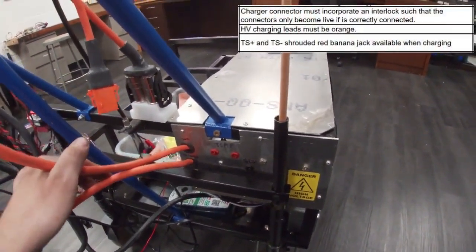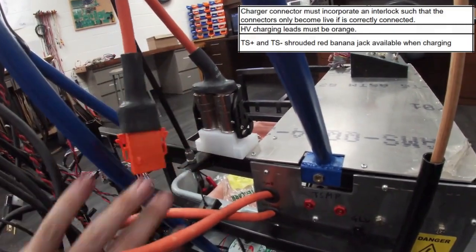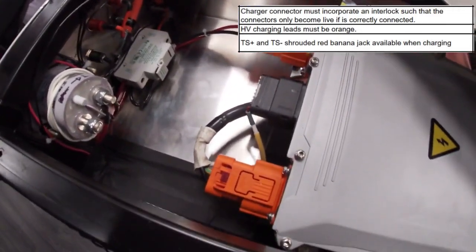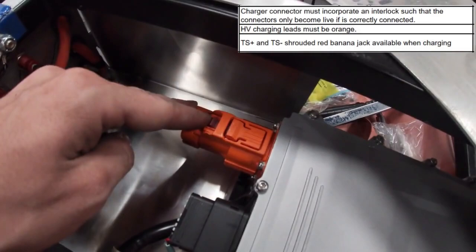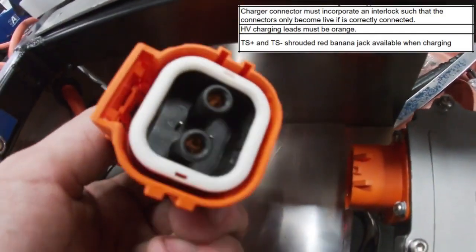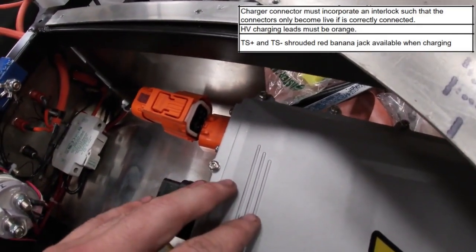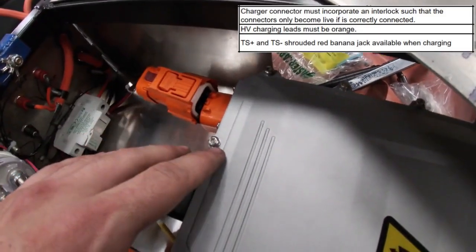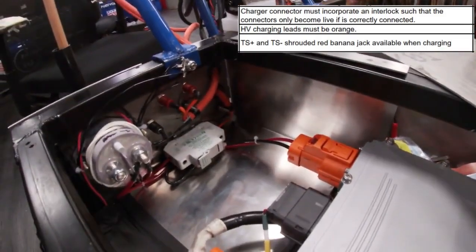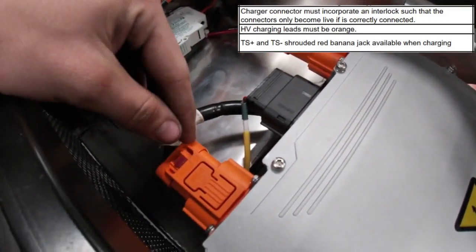This is our charging cart with two orange leads for charging: one for the tractive system measuring points and one for the actual charging, both using the same connectors as the car and both containing interlocks. The charger has three connections: one for low voltage, one for AC input, and one for the high voltage DC charging leads. Both connections have TPA assurance, and inside the connector there is an interlock circuit connected to the internals of the charger. The charger has a number of safety systems including inrush current limiting and undervoltage/overvoltage detection. If voltage is not detected at the connector, the charger will not start charging. This means all tractive system connections must be properly connected for the shutdown circuit to engage, along with the CAN communications connection and the connection to power the charger itself.